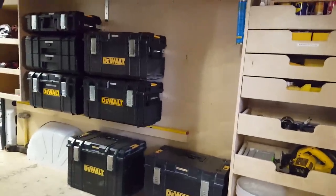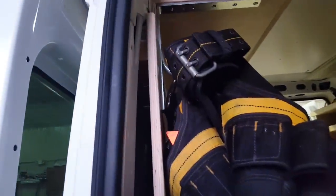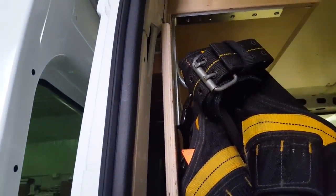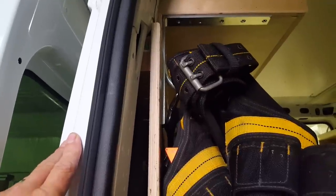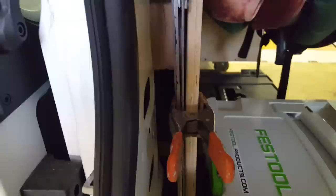The way we did this build, it has two two-by members that we attach to the outer cross members of the van, and with that we're able to attach the plywood. We used three-quarter pre-finished plywood everywhere - plenty of beef to mount things and makes it a little nicer inside. You can see the two-by up top there in the middle; it ended up being a two-by and then another one we planed down to about an inch to keep everything nice and straight. At the bottom we just did some simple pocket screws and glue to the subfloor.